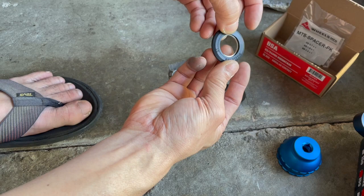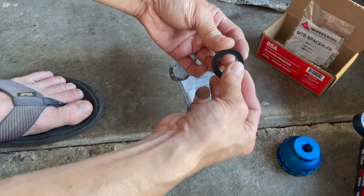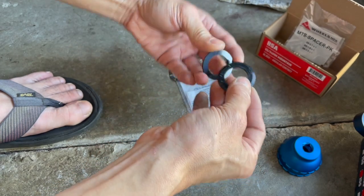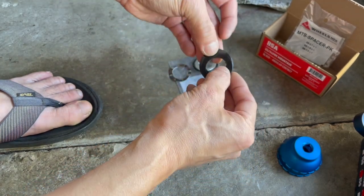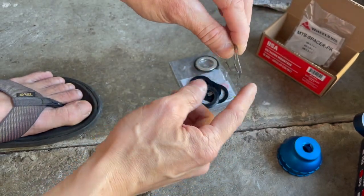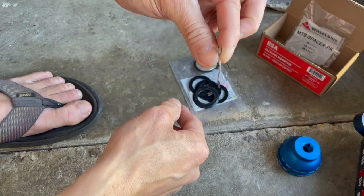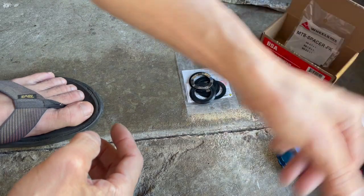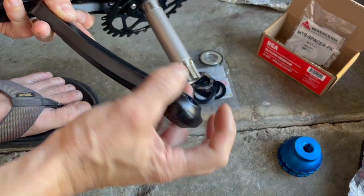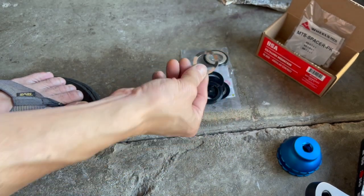You can see the metal on the inside here - that's the smaller diameter, so that's 22, and that's 24. All these spacers here are shims - these are all 24. This one is interesting - it's different from other bottom bracket designs. The GXP uses a spring washer, a wavy washer that acts like a spring. They use that instead of a preload adjuster. For example, the SRAM DUB bottom bracket has a little tensioner you spin to preload the bearings. This one uses this spring to preload the bearings instead.